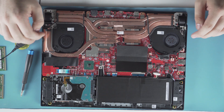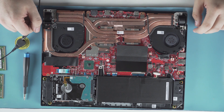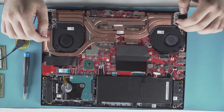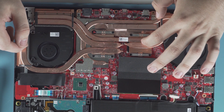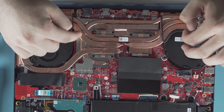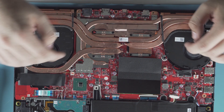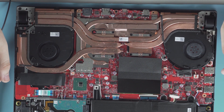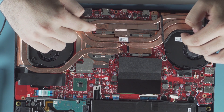So that's going to complete the upgrades for this ASUS. While we have it open, let's talk about a few more things. Looking at the structure, these copper pipes and the whole cooling system here are for your GPU and CPU. You can always tell the difference — your CPU is always going to be the smaller side, while your GPU has all the surrounding memory chips and other components. If you look at this section, it's actually numbered. So if you were to take this off and repaste it — or apply liquid metal to your system — all you would want to do is follow the numbered screw pattern laid out for you.